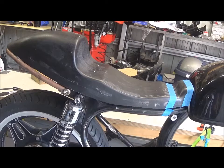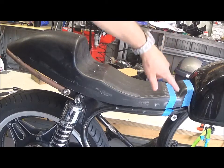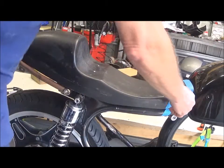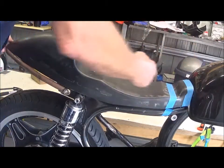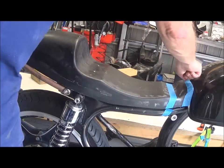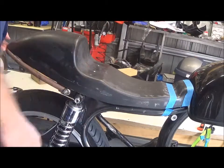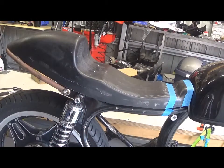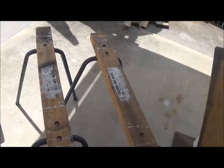So there's the seat back in place — it's all fitting nicely. It's sitting back a little bit, and that's because now I have to adjust the front end where it abuts against the tank. In order to make it fit, I'm going to mark the amount of distance that I've moved it back, mark it along, and cut it equally in distance from the tank, and that should bring it back to its desired position.